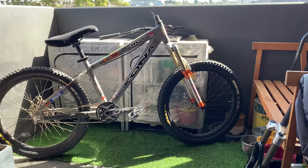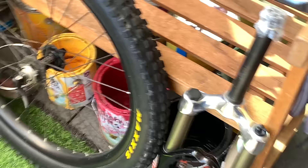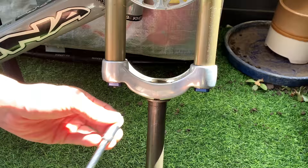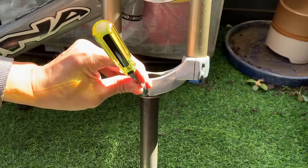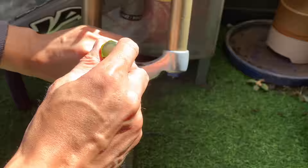Taking off the wheel and taking off the forks — they came out pretty easy. What I need to do is take this crown race off so I can put it on the new forks. I don't really have the tool, so I'm just going to tap it with a screwdriver — not the best way to do it, but just make the most of what you've got. Put the screwdriver on the edge and just tap it, keep alternating both sides. After a while you can see it loosening up and it'll pop off.